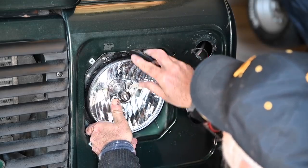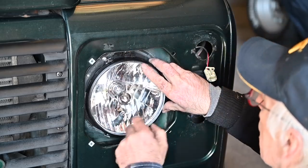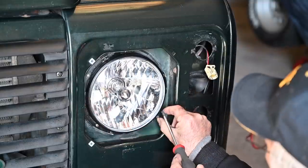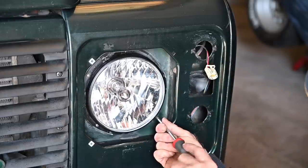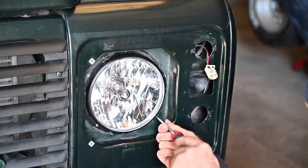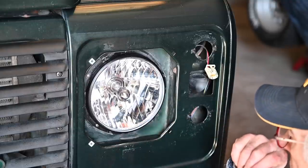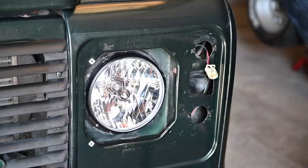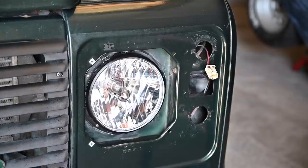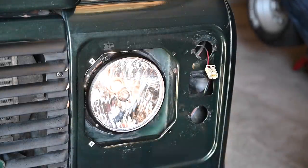Now I need to slide the headlight into the adjustment screws — it's a bit slanted so make sure you have it in the right position, as these screws are kind of double-headed. There's just one more screw to put in to hold it all together. There's another bulb position visible but I have no cabling for it — it's a kind of parking light, doesn't matter, doesn't hurt. Let's turn on the ignition and see if we have light — and that seems to work!